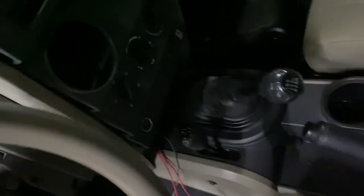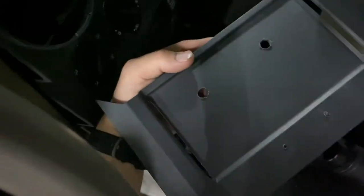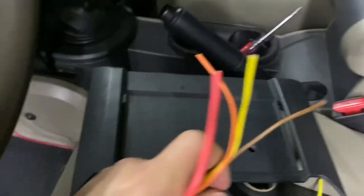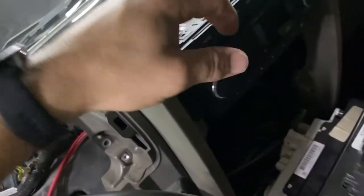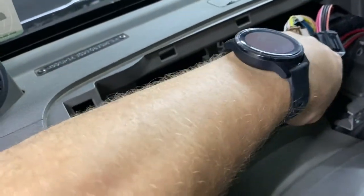I'm going to wind up mounting mine right in there. On my Jeep there was a little net right here where you could put some papers or a pen or something — I took that net off, just cut it off, and drilled a couple of holes to run the wires through. Those will go through there and then I screwed the actual mount to this. I'm routing all my wires up underneath here, up through the dash — I took all this apart across here behind the speedometer. I'm going to zip tie it and probably put some wire loom on it all the way through.